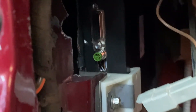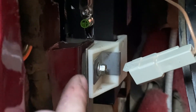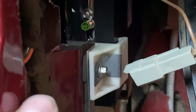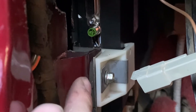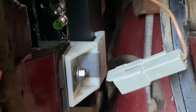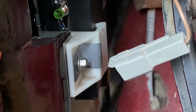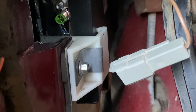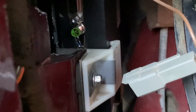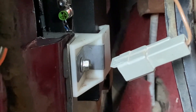I need to move that connector down a little bit — it got jostled or moved getting in here. I had to cut the bolt hole that would normally be for the hold-down bracket for the ECM. I found the 13/64" drill bit worked perfectly — I don't have any metric bits, but that 8mm retaining bolt went straight down in there and snugged up perfect and tight.